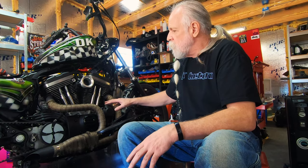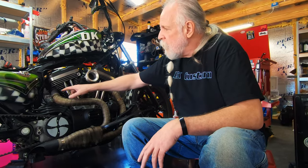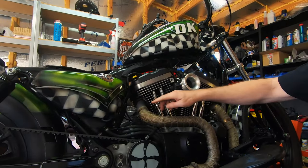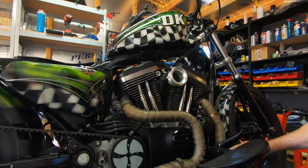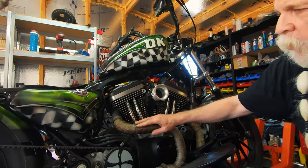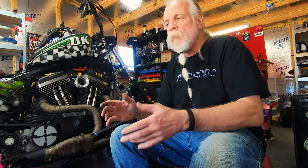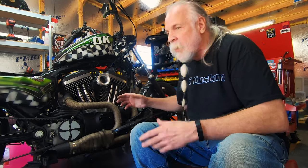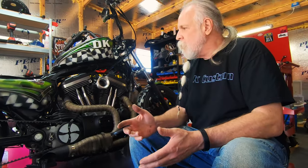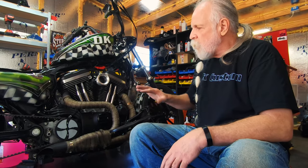Obviously I have it on here for a few reasons. Number one, this is a custom exhaust that Devin and I made. These are the factory headers from this 2009, factory all the way to about here, and then we added pipe after that and welded it together. Rather than spending a lot of money to make the welds perfectly smooth and getting it chromed or powder coated, we actually used barbecue paint — put on these pipes almost 10 years ago and then wrapped. And of course it keeps the heat from radiating out.